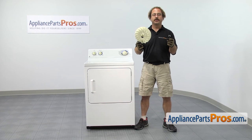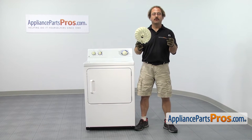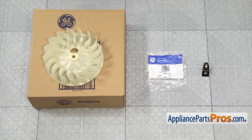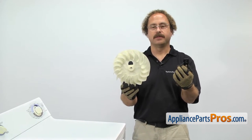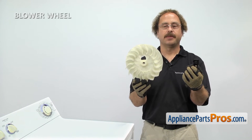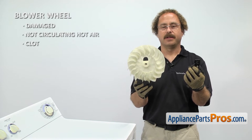It's going to be a very easy repair. If you already have these parts, great. If not, you can click on the link below or get them at AppliancePartsPros.com. When you open up the packages, you're going to get the blower wheel and the clamp and screw kit. The blower wheel and the clamp are located in the blower housing, and the blower wheel circulates the hot air through the dryer. The main reason to be changing them out is if the blower wheel is damaged and it's not circulating the hot air and the clothes aren't drying.